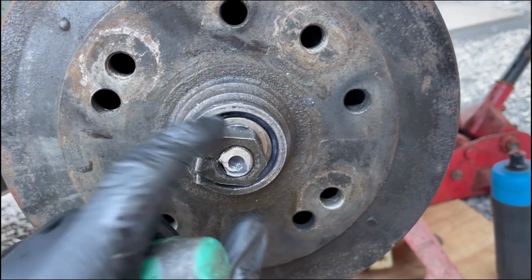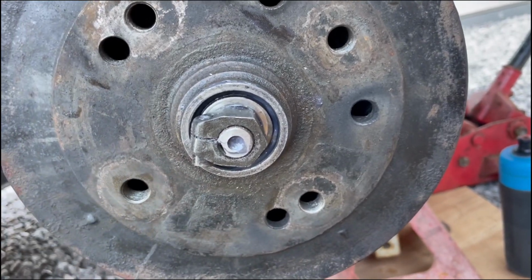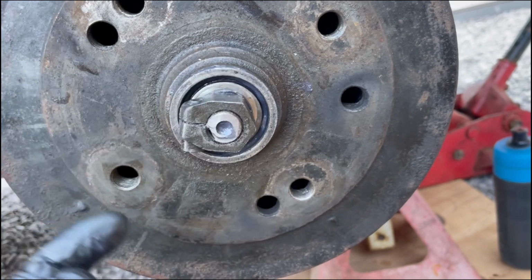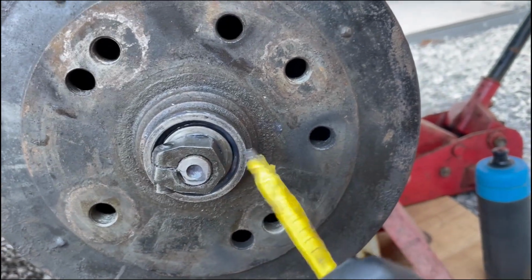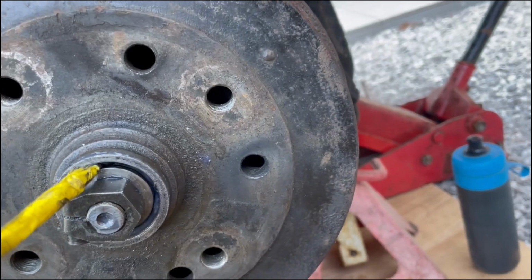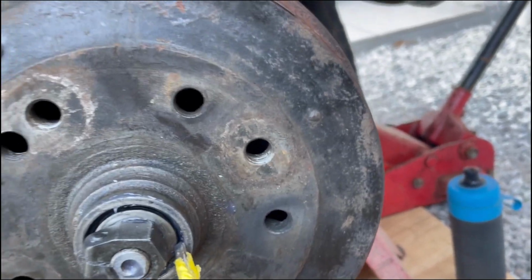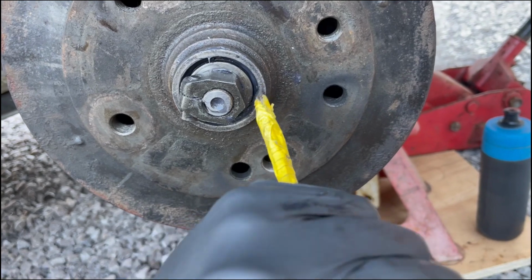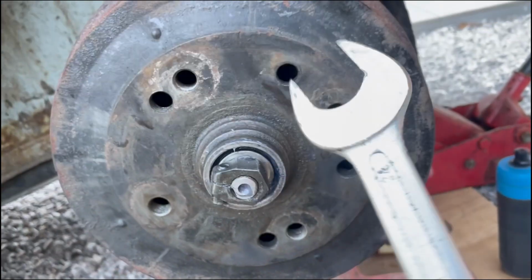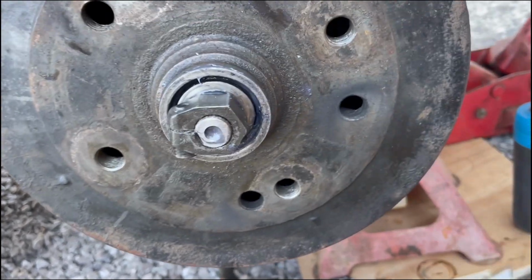You really don't want this to be too tight, because if it's too tight the bearings will get hot, and I've heard of extreme cases where the bearings get hot, this snaps off with the heat, and obviously dire consequences. So you do want a decent bit of play. Basically what I do is I use the edge of a flat screwdriver to check that the thrust washer moves. Now that doesn't, so just go back and knock it back a little bit.